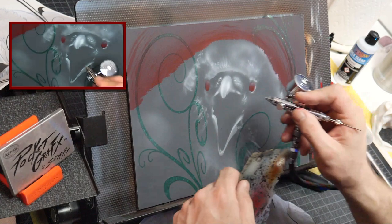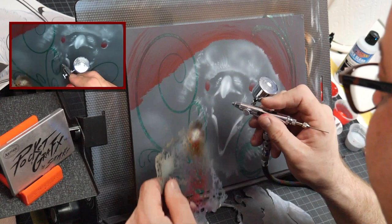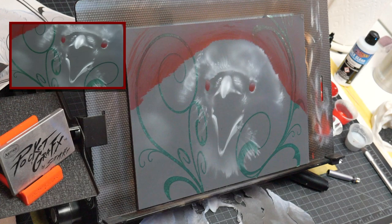What do you like to use for masking material that you can cut? So for that, you can cut on the plotter that stands up to urethane paint. This is what I use here. This is all the FBS line. So whether it's FBS gold mask, which is paper-like material, but they make it in a plottable form, super thin, semi-transparent. You can see through it, holds up to water-based, solvent, lacquers, anything you want.